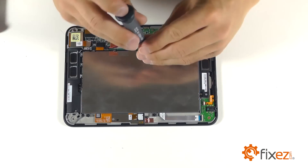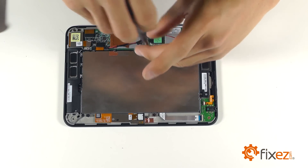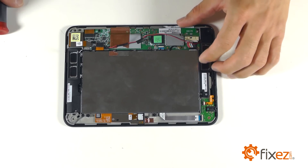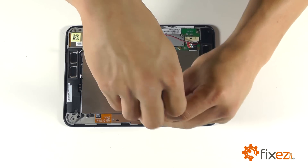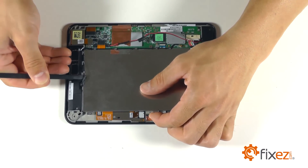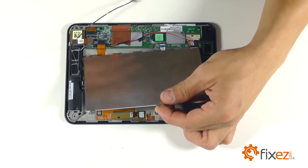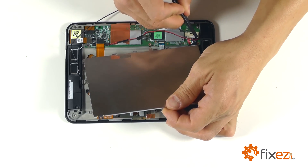Let's work now towards the removal of our batteries, starting with the single T5 Torx bit screw that requires a specific screwdriver for removal. Then we can address the other four Phillips screws that are secured into place. Don't forget to peel the wire out of its channel in the metal cover for the battery. Now we can back out the plug connection at the motherboard and remove the battery from the Kindle.